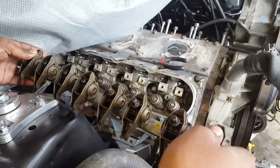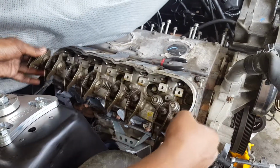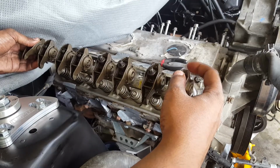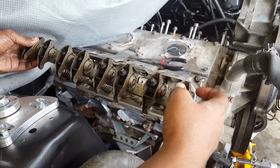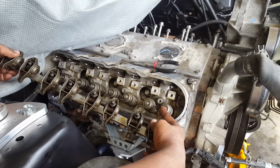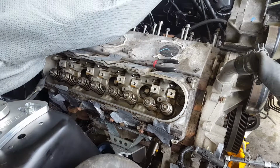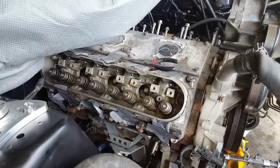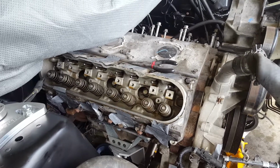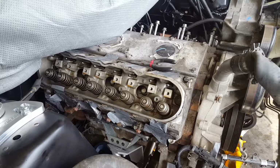Okay guys, so I put in all the push rods, and they're all in there. So now I got the rocker arms here, and I lube the contact points with my finger. So I put some oil here where it's going to hit the push rod, and here where it's going to hit this guy. And I'll put some here as well, just real quick before I forget. I don't think you should have those points dry. Just have something on them.